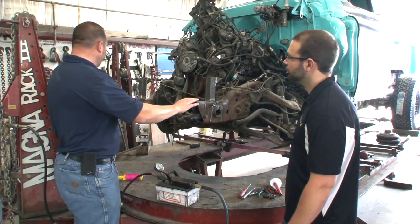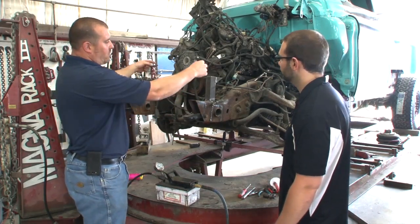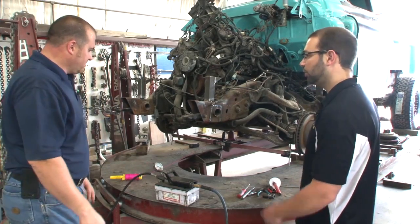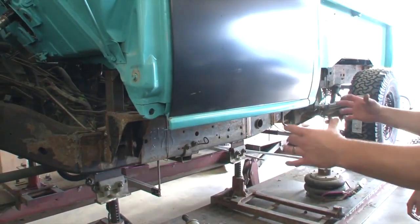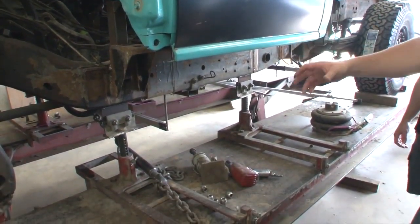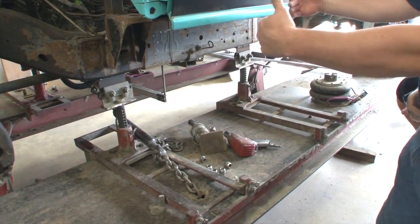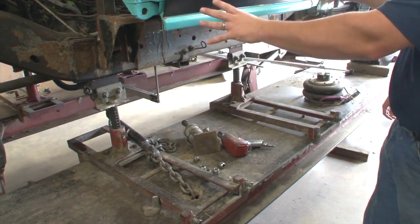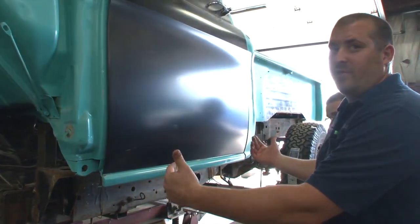This thing's swayed over this way, so now we got tension pulling forward here and sideways over there. It's tied down in four corners. We weld these brackets on the frame so it holds it in four points there. We also got chains going across here so they're pulling that way — the truck will not shift. We got everything tied down from here back squared up so as that goes over they cannot move anything else off the frame rack.